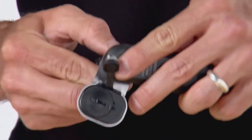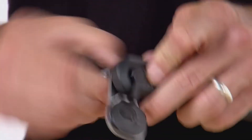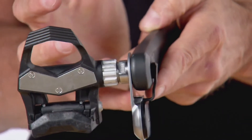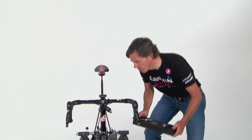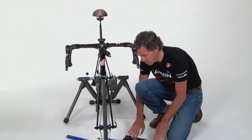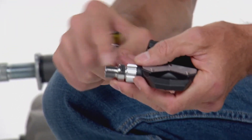I'll demonstrate off the bike to show what a successful fit looks like. After tightening down, we see a slight gap between the pedal pod and the Shimano crank, which confirms a good fit. For first-time installation of Vector, we recommend starting on the left side of the bike — you're free of the drivetrain, which makes installation simpler. Two pedals and two pedal pods come in your Vector box. The pedal pods are not handed, so they can go on either side of the bike.